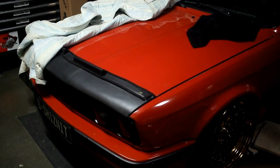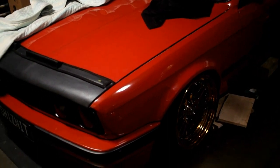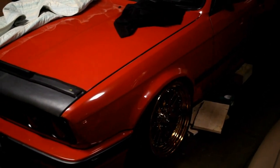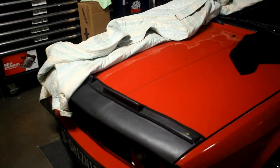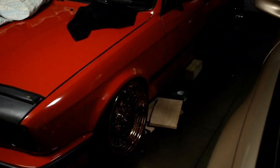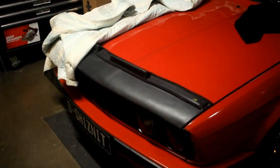They look good in there. If you're doing this upgrade, watch out for your offsets — I don't think I can use my bottle caps anymore, so if you have bottle caps and want to do the upgrade you'll need to get at least 15s or 16s and worry about offset for the caliper sticking out. If you have spacers like I do, you'll most likely need a machine shop to ream the inside out so it goes deeper because of the hub sitting back farther. Overall it's a worthwhile upgrade and definitely worth the money.